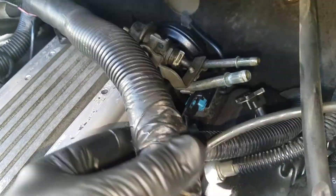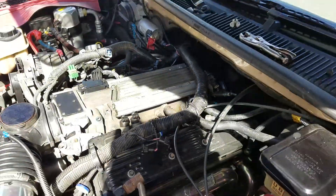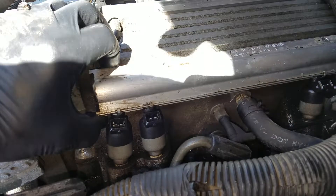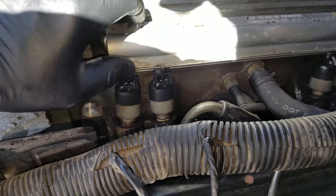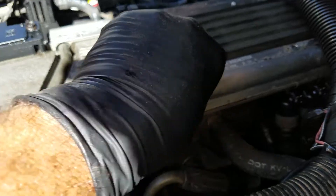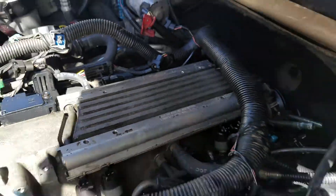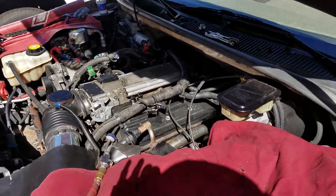This is as good as you're going to get with this big old huge harness. There are probably a few more wires I can disconnect to get it off, but at this point the injectors are just about ready to come out. WD-40 is your friend here — I sprayed WD-40 on all the connectors and on all the fuel injectors, because they could be stuck in there really good. Wriggle them around and see if they'll pop out. It's probably going to take a little more force — they're stuck in there good since they're the original ones.